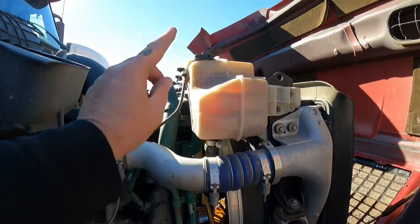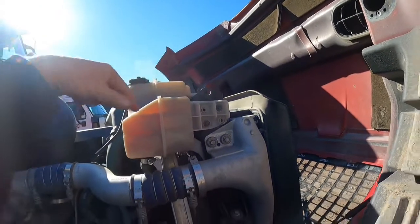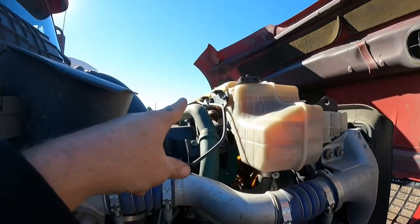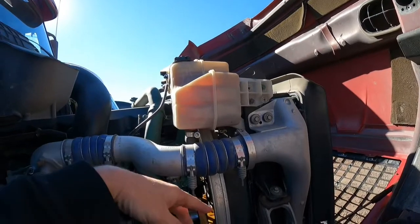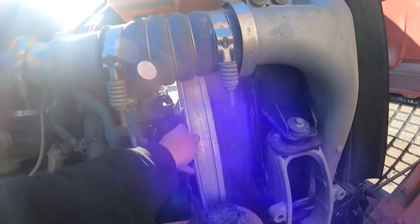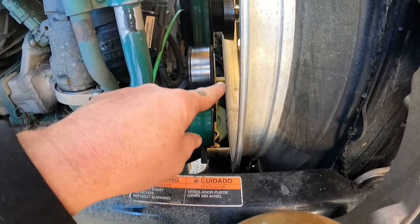To do these, you're going to want to empty the coolant out of the coolant reservoir. There are bolts on either side, four across the top of the front, this hose, that wire, and then two overflow hoses on the front. Then the reservoir will come out — obviously drain it first. Your fan shroud has four bolts as well. I'll show you those once we get going — there's a post right there holding it, and another one there, and two more on top.